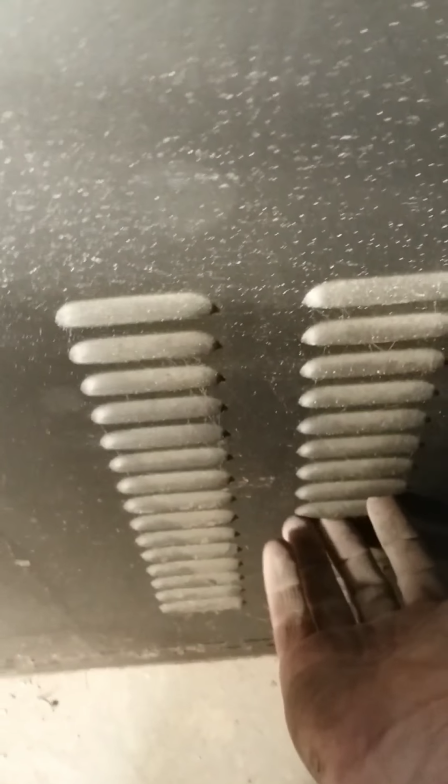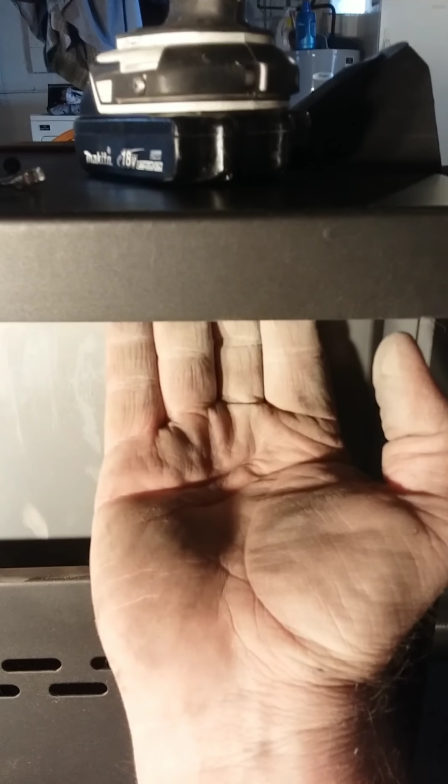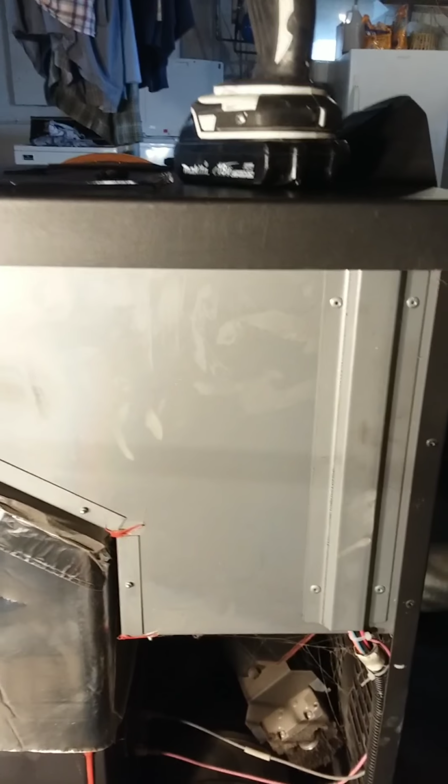And you just got to open up these panels. Take the screws off back here. There's 3 of them. Then you have to take the panel from the vents. I'll show you. From these vents, you kind of grab it and lift up because it's tucked behind here. It's got to go up and then out on the bottom and then down and backwards. So to the back, up, and then down. That'll get that off. All right.